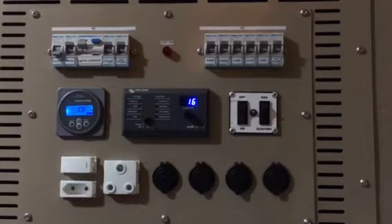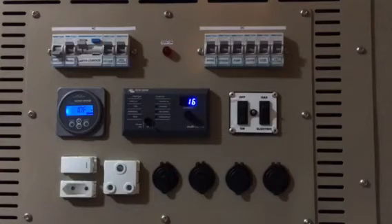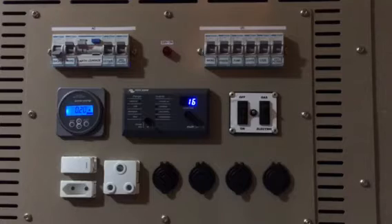It's about quarter past 10 on a Sunday morning. My panel is flat mounted on the roof and as you can see my battery is still running at infinity. At the moment the battery is driving my National Luna — it's a 90 litre twin — as well as the USB lights inside being on. That's the amps the solar panel is giving at the moment; because we're not drawing too much power it's just keeping the battery at a trickle state.